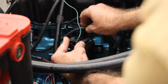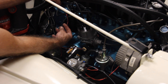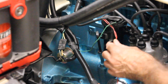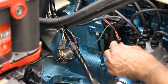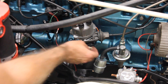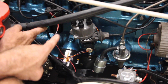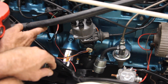That splices out and connects to a female connector — also red with a black tracer — which is for a capacitor jumper. I don't know exactly what that is; if you know, please advise so we can all learn. Further down the loom, a few more inches along, is your distributor connector. This is just an orange, purple, and black line that connects into the plug coming out of your standard Ford distributor. Most of the ones placed into the inline-six 258 motors on the AMCs were Ford Motorcraft distributors.